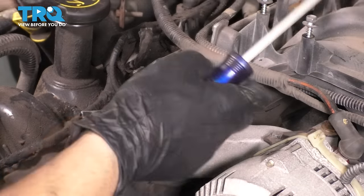A couple more things is these right here are holes where the head bolts go. This one has a dowel pin, same with one back there. And these are all coolant ports, as you can see. So the triangulated ones are coolant ports. The small round ones are head bolt ports. And these three at the bottom are oil drain ports for where the oil drains back down into the oil pan from the head. So don't blow any air in there or oil will shoot out the oil pan from, you know, pressure building up and oil shooting out.